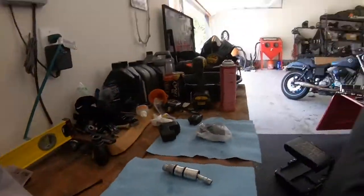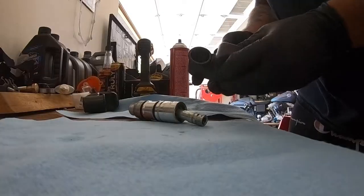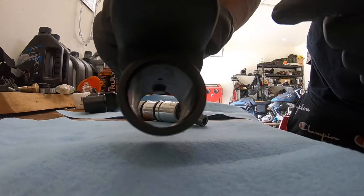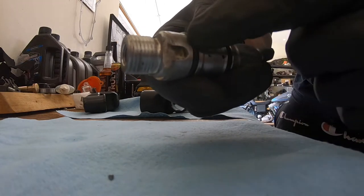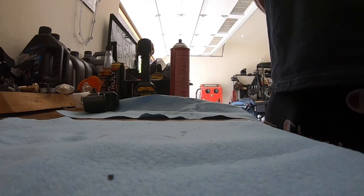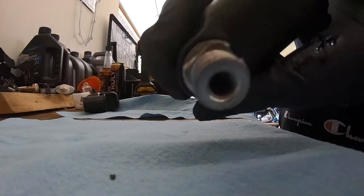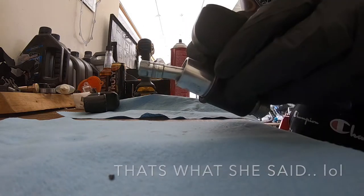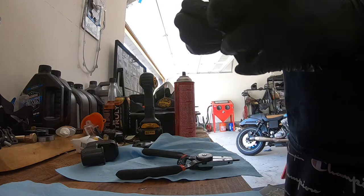Here's the new one right here. So let's take a gander and see what we can do. It's directional — you can see inside there there's a little notch back there, and that notch needs to line up with this notch in the plunger. So just go ahead and slide that sucker up in there, like so. Get that notch on there nice and good. Slide it in, slap a circlip on here and you're good to go. So this little brass circlip right here — it's going to go on there, like so.